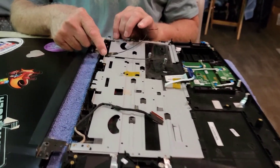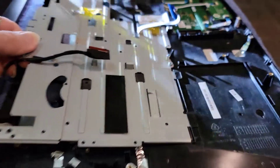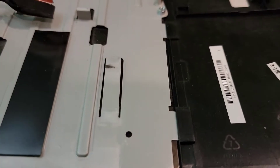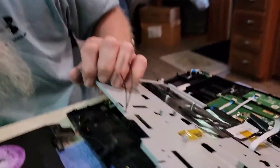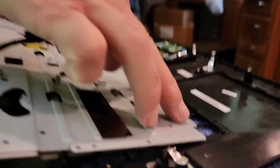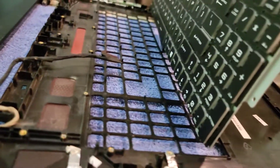We've got tape here we have to undo. Something else is holding it — let me look underneath and see what else. All the keyboard is holding it, but as you can see, these tabs are free to slide out once you pull the existing keyboard up. Try not to scratch it. I'm trying to get the keyboard to release — and there it goes. It lifts off just like that. There are two tabs that were giving us trouble that went in there.